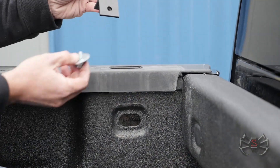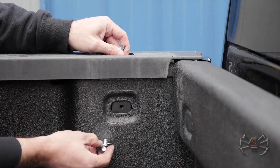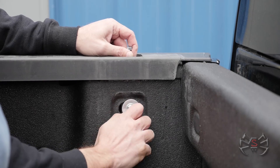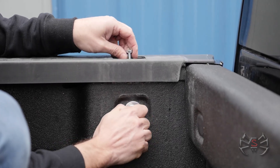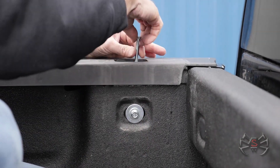On the other stake pocket, we got the small bolt removed and the long one on there for a handle. Put it down in here — you can see the stake pocket bracket — and through that hole you put this in, get it centered on that slot, and get it as finger tight as you can so it doesn't rotate around on you. Then pull the bolt back out.